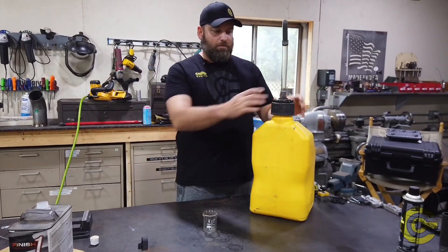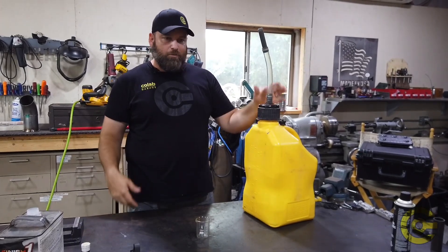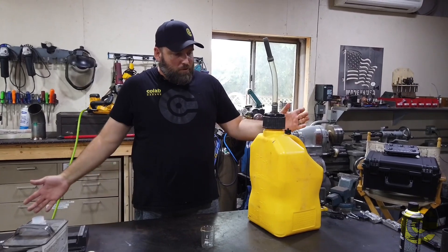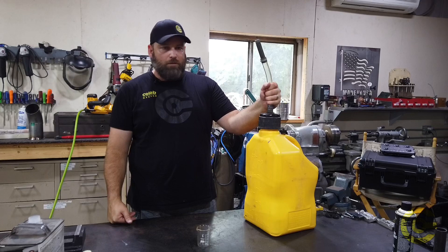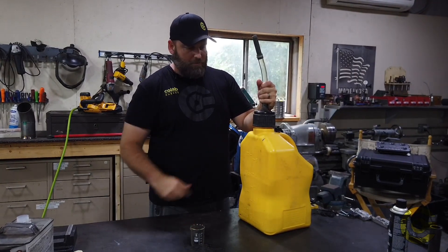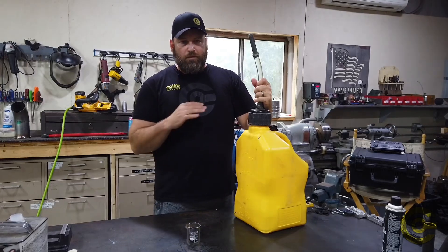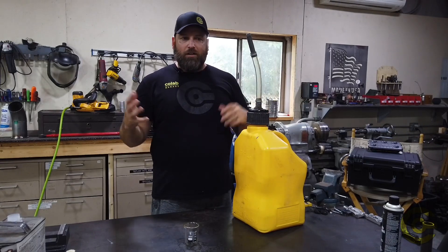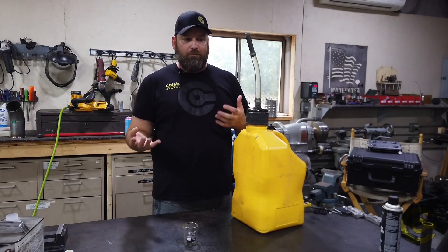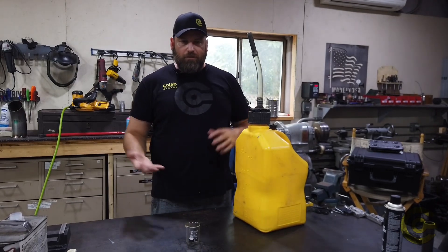This is going to be much more practical, but it's going to take us a lot longer. This is just some pump E85 — normally here in Atlanta we get anywhere between 75 and 83, so we'll just call this E80. It's been sitting out for a little bit, so it's not really fuel I would put in a car, but it will definitely suffice for this test. We're going to take that same part that we subjected to the brake cleaner and put it in this beaker filled up with E85. Really the test here is: can this stay submerged in fuel for extended periods of time — like months? We've done tests for fuel systems where the rubber hose says it's rated for ethanol, but you come back months later and the hose is starting to deteriorate. So if we ever want to start making fuel hats, fuel pump hangers, and things like that where you're actually submerging this stuff in fuel, that'd be great to know.